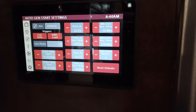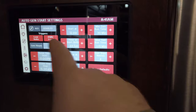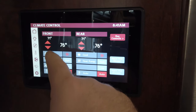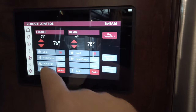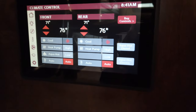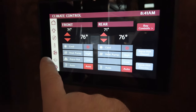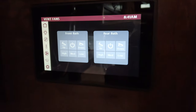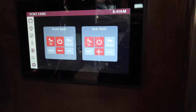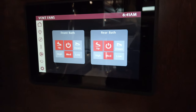If you go into AGS, here's how you can program all your triggers as far as voltage — low voltage and HVAC. If HVAC loading is on, it just goes off whatever you have the thermostat set at. Here's your controls for the thermostat. You've got a front and a rear unit. Your AquaHot is only single zone for the entire coach, but you do have a rear heat pump and a front heat pump. As far as heating with the heat pumps, maybe down to 50 degrees, but I personally would just use the AquaHot system — it's a lot quieter. You've got vent fans in the bath and the rear bath. If your coach is hot, the best way to get the initial heat out is to use those fans to pull fresh air through the coach instead of making your AC units work super hard right off the bat.